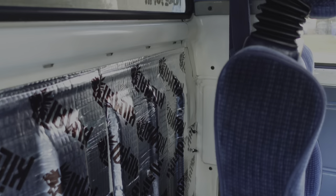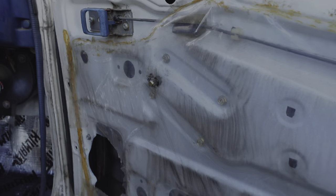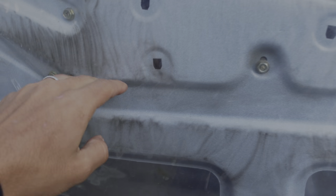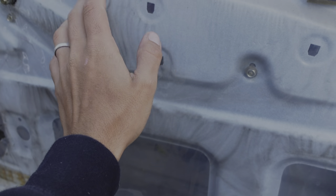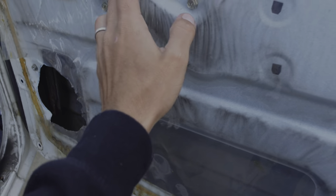Now that I've got the whole floor done and the majority of the back, I'm going to be doing the doors. Luckily we have some access panels down here — I just got to move this plastic. I'm going to clean the backside underneath back here so we can put some sound deadening as low as I can and go as high as I can. I'll probably be around here on the back on the outer skin of the door, and I might put one sheet right here in the middle to help get rid of that little tin sound.